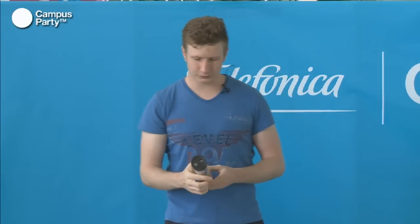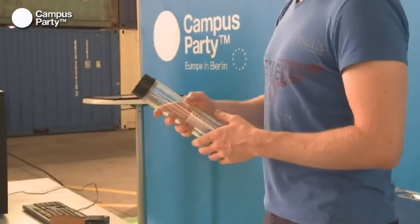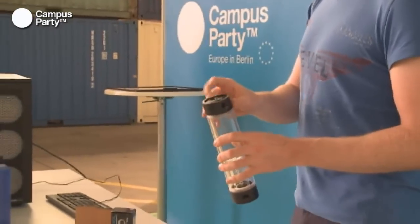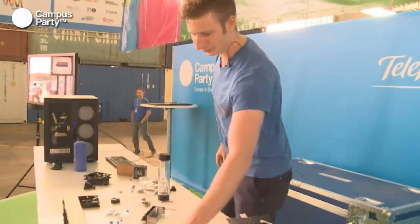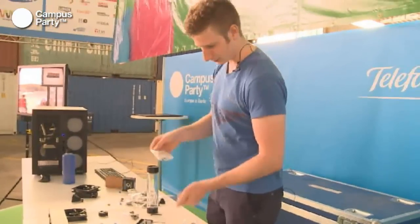And with this reservoir, you have to remember to close all of the plugs that you're not going to need. Because obviously, when you're putting this in your system, if you forgot to put a plug in, then if you tilt the computer, you're going to have water all over the place, which is not desirable.